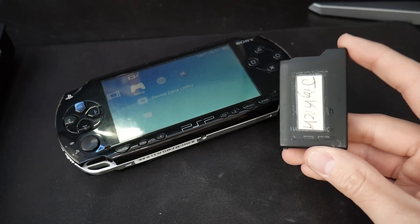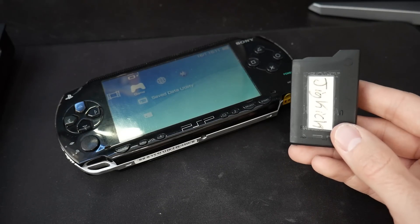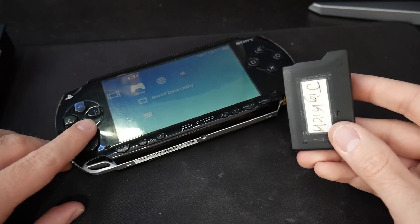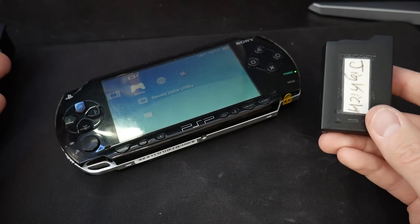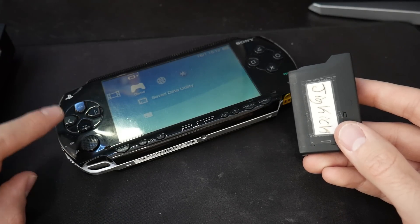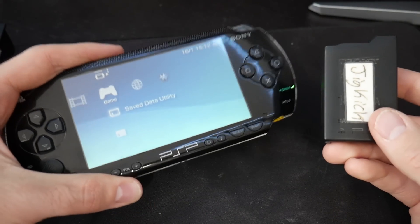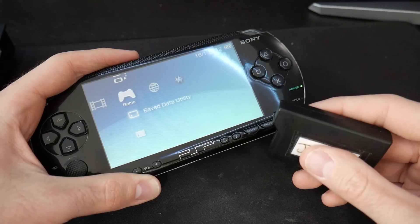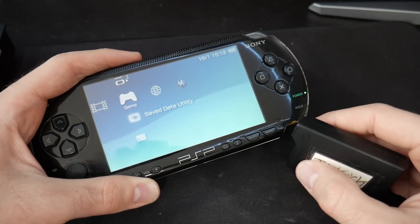This is a Jig Kick battery - a modified service mode battery, a tool, or as it's more commonly known, a Pandora's Battery for the PSP. Without getting too technical: you end up changing the EPROM on the battery itself so it boots up the PSP into a service mode. You put the battery in, the PSP automatically turns on and it is looking for some special files which are on a memory stick that you set up yourself.